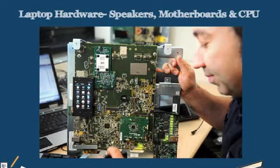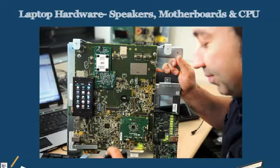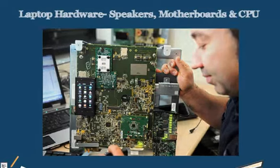But when you do make the decision to replace our system board, remove all the plastic housings around our system board. Make sure that the power is disconnected and remove all the components, and always be sure that our power and battery pack are removed, because our battery pack can hold the charge and we don't want to receive a shock if our laptops accidentally turned on.